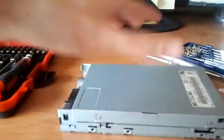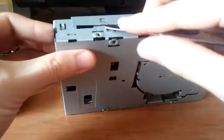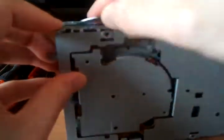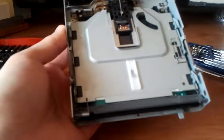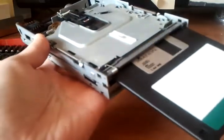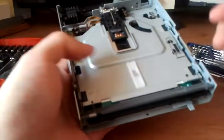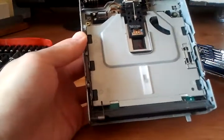First thing, let's remove the top here. You'll notice there are actually some mounting tabs on the side, two on each side, that you need to get in there with a knife just to pry off enough so you can get this guy off. It's actually really interesting mechanisms. I've taken apart a lot of floppy drives. Basically they're all very similar with a front-loading caddy, which when you insert the disc, it actually lowers the drive bay and clamps these fingers down onto the top and bottom sides of the drive in order to access the data as the motor spins the spool.